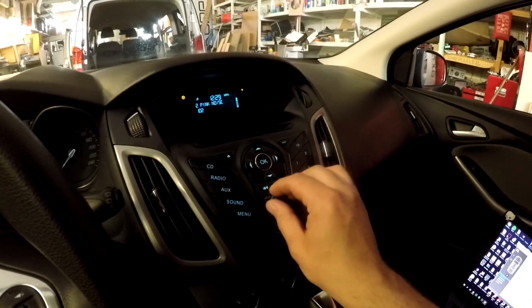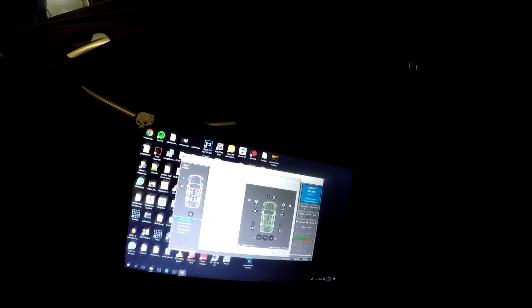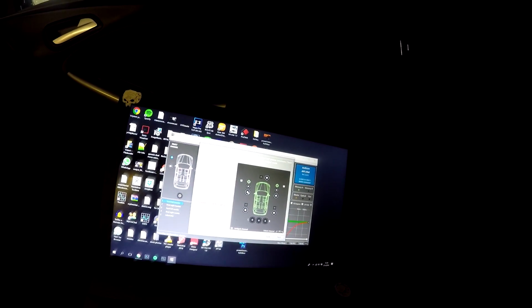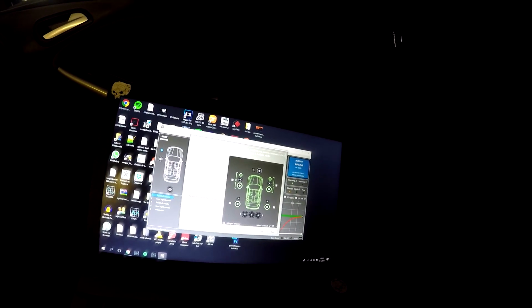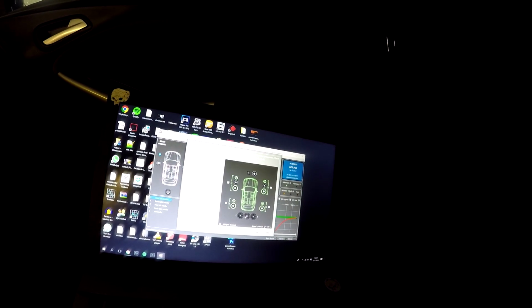Now, when everything is okay, we can go back in here and lower the volume down to zero, then go next and next, and now we will be selecting what kind of speakers this car has. I know that the front has two-way speakers from Audison, I think the 2 ohm series. So we need highs from the tweeter and mids, and we can check here that it is only one channel coming to the left and right. Then we have OEM back speakers with a mid and a tweeter, and then we have a subwoofer out here.